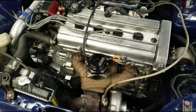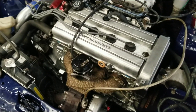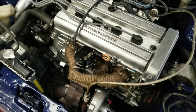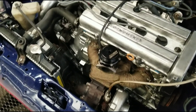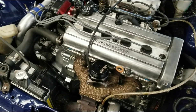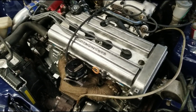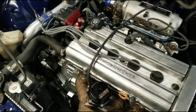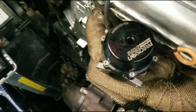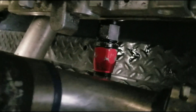I just hopped outside the car — the tune is pretty much dialed in. The customer actually knew the octane rating, wastegate spring size, and injector size and sent me an email — just wasn't filled out on the dyno sheet, no big deal. They don't have the injector data card though, and I couldn't find it online. As I'm tuning and becoming aware of my surroundings, I hear an abnormal noise — not something I'd normally hear — so I stop the car and hop out. Something's missing on the wastegate and I can see the bolt on the ground.